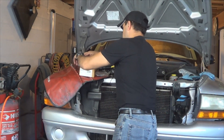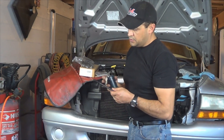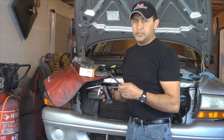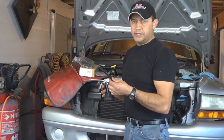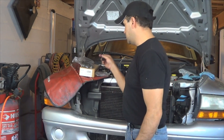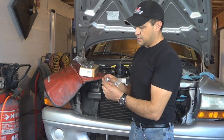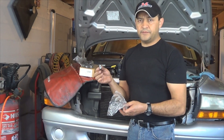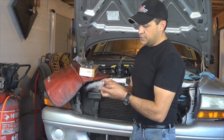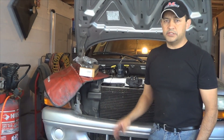So with the torque-to-yield head bolts, for the longer ones you want to coat the threads with a little bit of engine oil before installing them, so they go down smooth and torque to the correct specs. Otherwise they will be dry and you will get the wrong reading. Coat them with engine oil and install them finger-tight first. The small bolts, since they are brand new, are already coated with thread sealant and thread locker — this will keep them from coming off, as they don't require as much torque. There is no need to add anything extra. Go ahead and install those finger-tight as well.